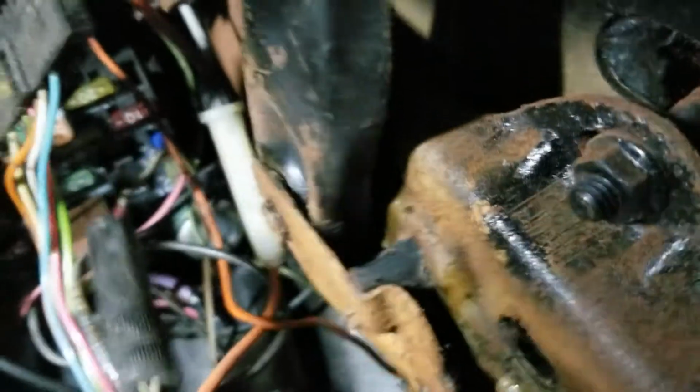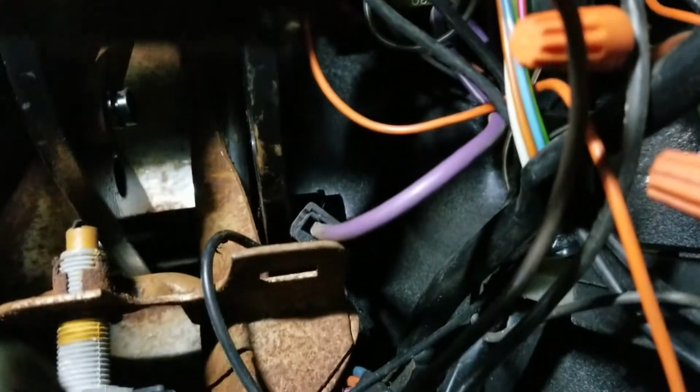So, we got the clutch pedal and whatever in. You can see it up there. This one, this is the clutch right here. And basically, there's just a big bolt that runs the brake pedal. The original automatic brake pedal is sandwiched in between those two pieces of metal you can see. One right here and the other one's over here. And it's just sandwiched in there. And there's normally a short bolt that just sandwiches those two in. And with the manual conversion kit, it just sticks out past this right here. And the clutch pedal is just hung on the end right here like that.